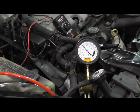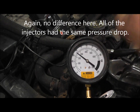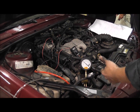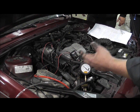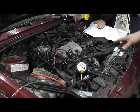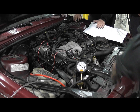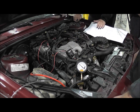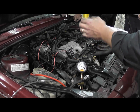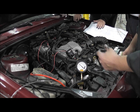All six injectors show a range of only 1.5 PSI from lowest to highest drop. Four of them dropped to 37, two dropped to 36. With a number one cylinder misfire as our main focus, this means the injectors are fine. We need to move in a different direction for this intermittent misfire. That is how you do a balance test on a vehicle where the injectors are covered by the intake manifold — it requires a sequential engine with individual control wires, and be extra careful not to jump the wrong wires.